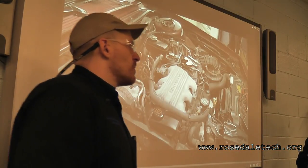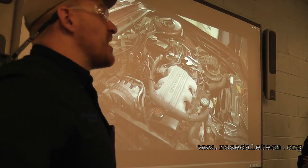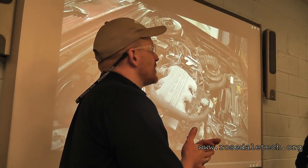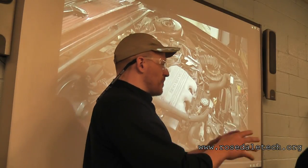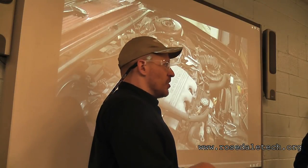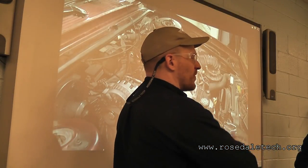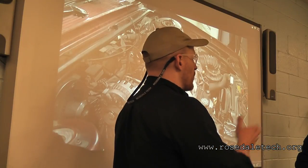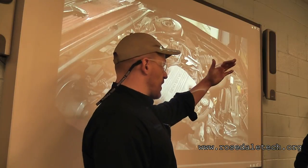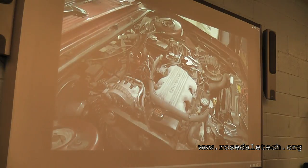What I did on the video you were watching — I was working with a connector. The difference is we're going to plug our tool directly into the injectors one at a time — that's the only alteration. We want to see our initial pressure reading, hit the button, make sure we're using the same pulse for each one, same setting on the tool, and watch our pressure drops on each one. Do not do this multiple times without cranking the engine over first because you'll hydrolock those cylinders. Once or twice each — if you need to redo one, crank it, run it, get that out, then redo it.